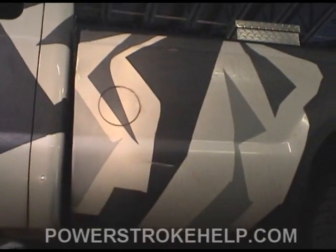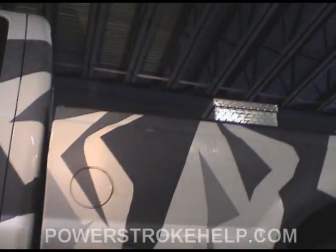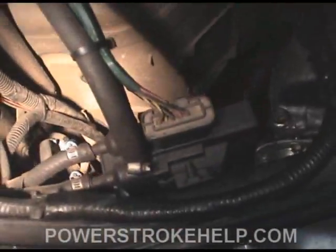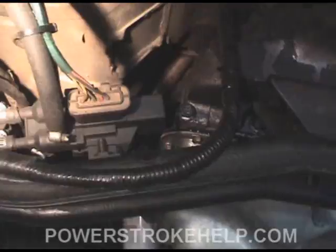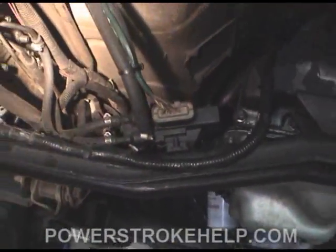On Spot the Shop Truck here, I actually have two fuel tanks — a primary fuel tank and then a big 100-gallon tank I keep in the back of my bed. The secondary tank lines come down and over to a switch. I've also split off the incoming fuel line from the main tank and brought it over to the switch, so I can switch them back and forth between the two tanks.